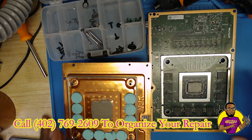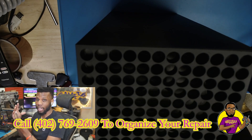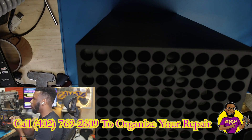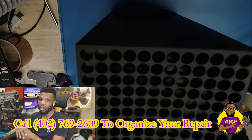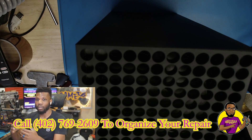Now we're going to put the whole console back together, turn it on, and let it sit for a while to see if it works. So we have our Xbox Series X put all the way back together — we applied new thermal compound, cleaned everything out, air dusted it all, Clorox wiped everything down. We're going to turn on the console and allow it to sit on for at least 10 minutes to make sure it stays on, doesn't heat up, and the fan doesn't kick on high. If it successfully stays on, that means the Arctic Silver 5 thermal compound we applied on the APU processor has successfully repaired the issue.